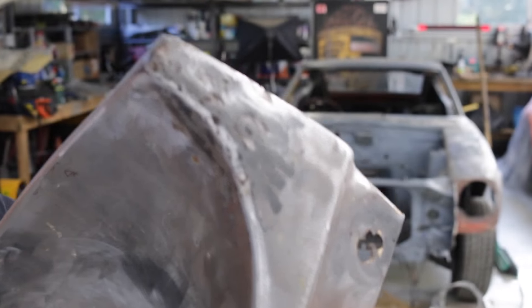As you can see — it's hard to tell by the angles — but a lot of that dent has already been pulled out. It still needs more work, and you can see that I over-welded in a couple of spots, and because it got too hot when I pulled it off, I did get holes in it. But the bulk of it — these bits will just grind off — and it's working really well. Overall, I think that works really well. Considering it cost me nothing because they were just bits of scrap I had lying around the workshop, I think it's worked really well.